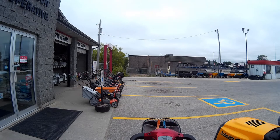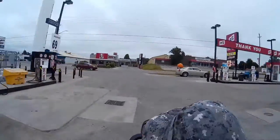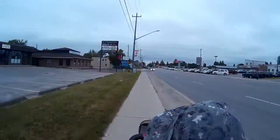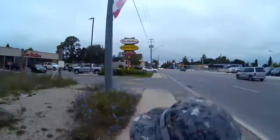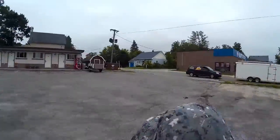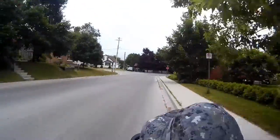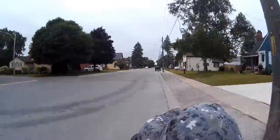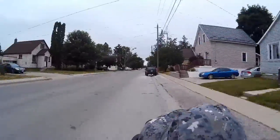I love the split rim. The other scooter's got split rims on it too, but you have to let the air out of the tire first, because the two parts of the rim are held together and bolted on all with the same bolts. With the Monster, there's five bolts holding the wheel on. You take those off and the whole wheel comes off, and then there's five more bolts on the inside of the rim holding the two pieces of the rim together.